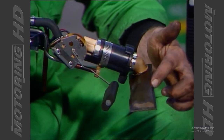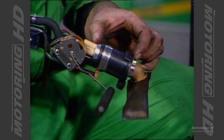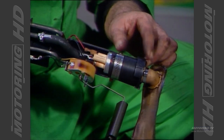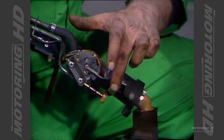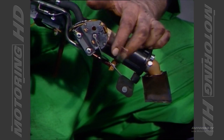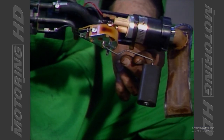Starting out at the bottom here with the strainer — this pre-filters the gas that's going to enter the fuel pump. That's the actual electric fuel pump right there. There are the two electrical terminals, the power wire and ground wire, secured with a little hose clamp. Over here you can see the float for the fuel tank sending unit. This is what drives the gauge on the dash of your car. There's a little rheostat in here; this float goes up and down with the fuel level to make that gauge read properly.